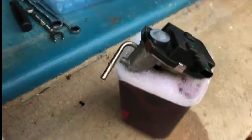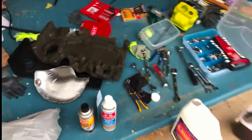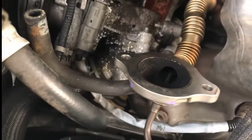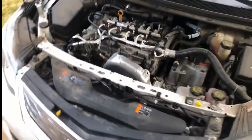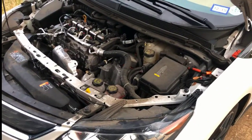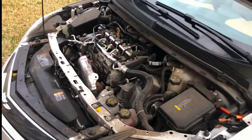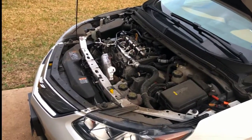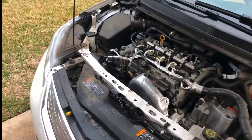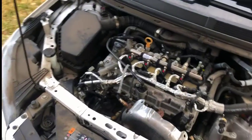I'm going to let this sit for a few hours and see if that breaks up the carbon. I'm also going to use some carburetor cleaner — I've got two different types I picked up from AutoZone. One of the major issues I'm having is here in Texas with auto inspection. My inspection is out and I can't get the car to pass inspection because of the EGR issue. It's got a permanent code in the system that will not clear unless the actual issue is resolved. I'm hoping that cleaning helps clear it enough to buy me a little bit of time, otherwise I'll have to pay $1,500 to have it repaired.